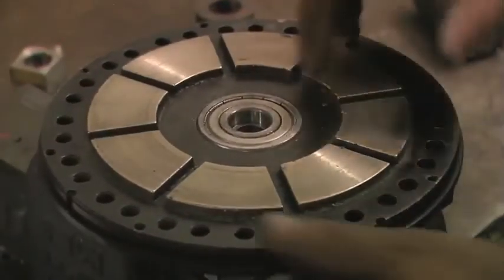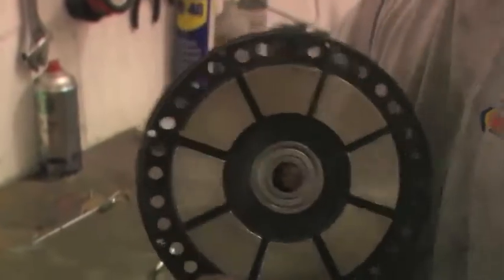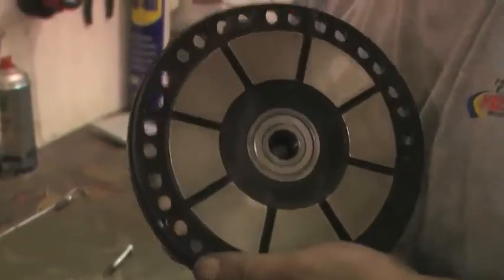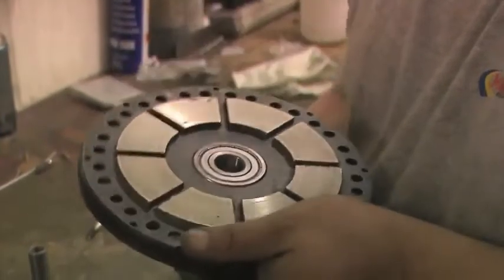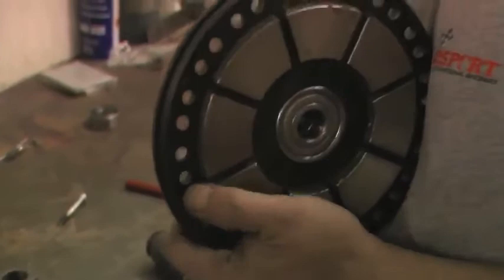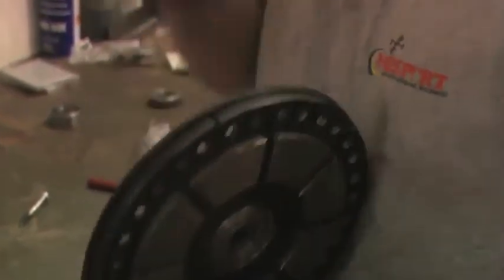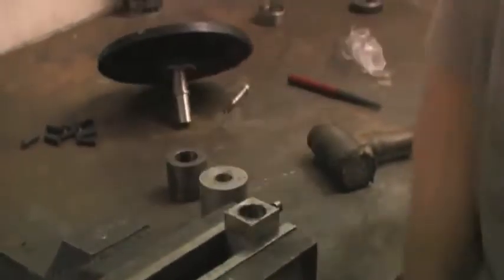If you can hear that, the sound changes. The bearings turn freely, but they're actually tight on the spacer at the moment. So if you'd put that in and the spacer hadn't been in the middle, it would not have pushed it through. And it is a really soft spacer, so you can't knock it either — you just end up ruining the spacer or having to change the bearings again. So be careful and keep them in line.